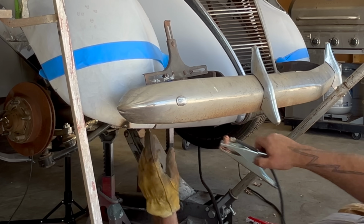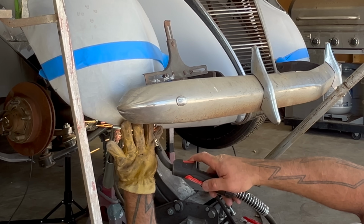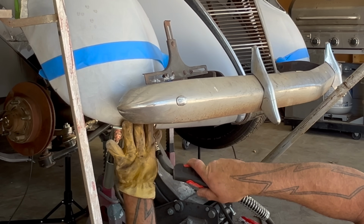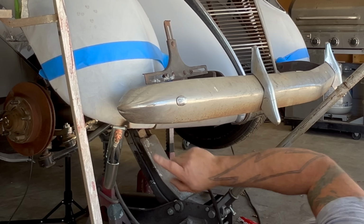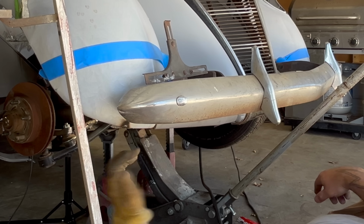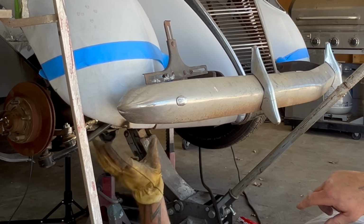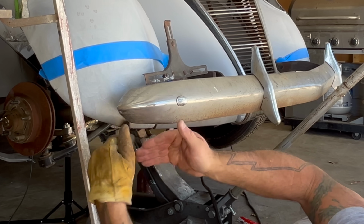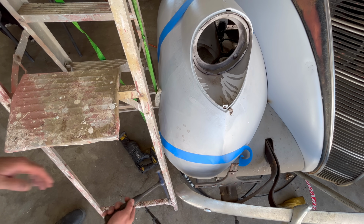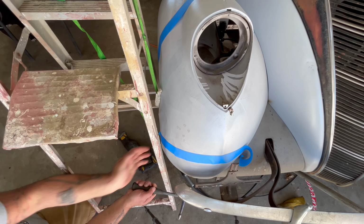Yeah. A little rip here that I mentioned too. I'm going to go ahead and touch that. So I'm leaving extra weld on this because right now I just want the reinforcement. I'm going to go on the inside, weld it up nice. That way I can grind this off and really finish it. I just want to have that strength. As I mentioned, this was the point where the whole panel was doing that buckle. Yeah, that captures it really well right now. I'm going to end up hitting this apparatus for the camera with the hammer, but let's just try this.